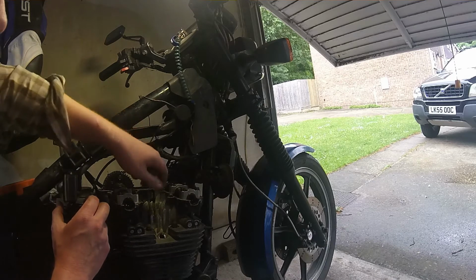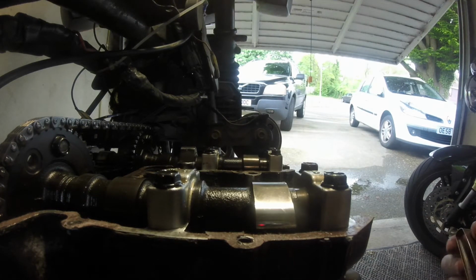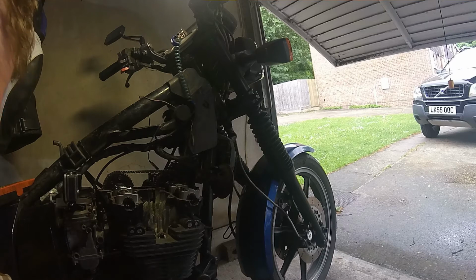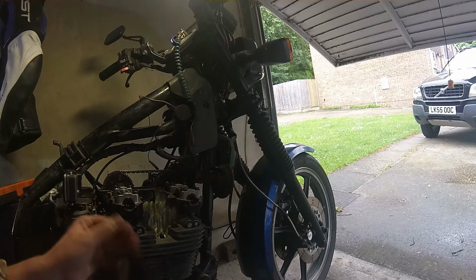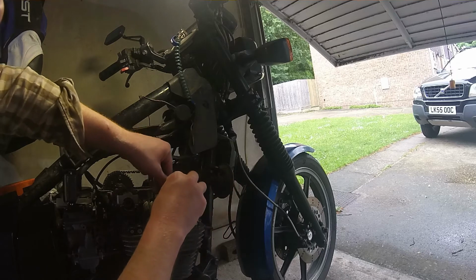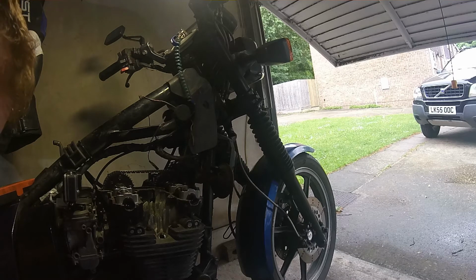So we'll do this next one. I can't get that 0.15 down to that exhaust valve at all. So the process again is go smaller. I wish I hadn't put these back upside down. So it's a 0.15 mil, so we want a 0.13, really. There it is, 0.13. So that goes in there, but it's very tight coming out. Too tight for my liking. Let's find, we should have a 0.12 maybe, if we're lucky. This gets annoying fast, looking for these.